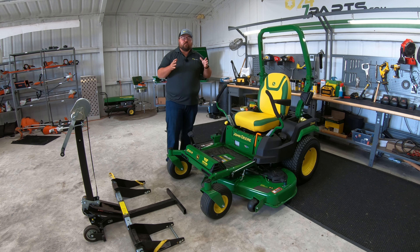The first thing we need to do is get the front of the mower up off the ground high enough that we can get underneath to work on those blades, while also making sure that we're being safe. What I'm going to use here is the MoJack Pro — I've got a video on that by itself, I'll drop that in the description below. If you don't have a mower jack, you can jack up the front with your normal car jack. Just make sure you're putting jack stands underneath the mower to make sure it is secured, and you may also want to chock your back wheels to make sure there's no roll away while you're underneath.